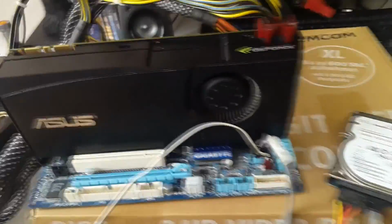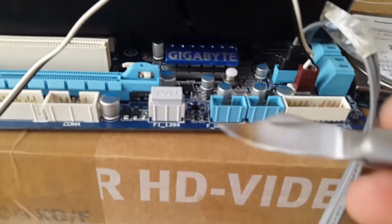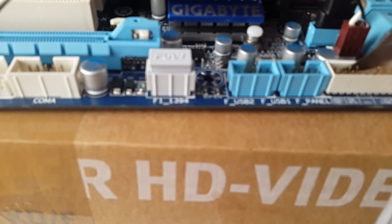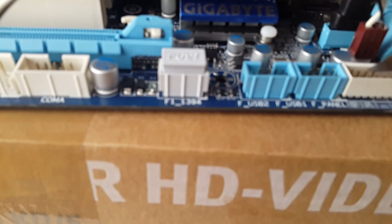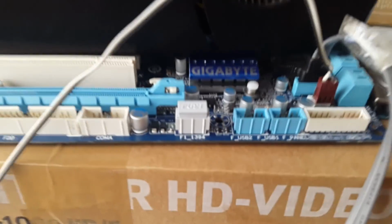Yeah. Made a little bit of a pop there. Alright, let's go. Powering up the PSU. No smoke yet. Brilliant. None of the fans are spinning. Telly didn't change. Hard drive over here, obviously. I forgot to mention that, I think. So let me just grab my tiny little knife and cross these power connectors over here. Which isn't doing anything.